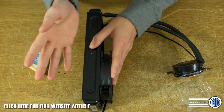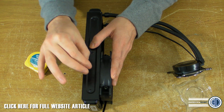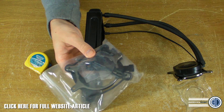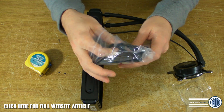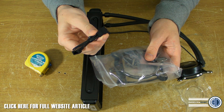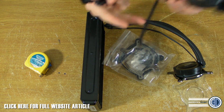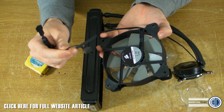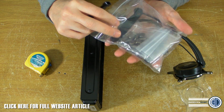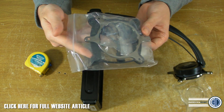Just keep that in mind. If you look through the case reviews I've done in the past, I always give you distances above the motherboard, so you'll be able to know whether this will support your case. In the little box of tricks we have a splitter to go from one PWM to two PWM - it is a four-pin PWM splitter, good for motherboards and fan speed adjustment. The fans that come with this are the PWM SP120L, which is a nice thing. There's a backplate and then all the mounts and screws you're going to need - it's all pretty normal run-of-the-mill Corsair bolt-in, easy-peasy sort of stuff.